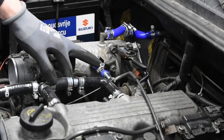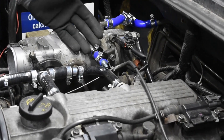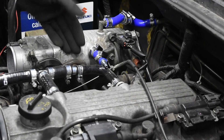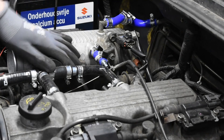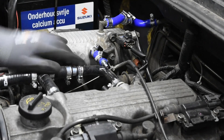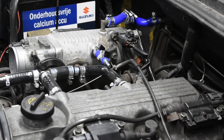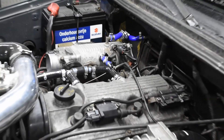The reason we put an adapter here is because we need a port for our blow valve. You could add another one if you want to keep the original. For simplicity, we just did it this way. An added bonus is that the car won't be sucking in all the oil fumes from the crankcase breather.